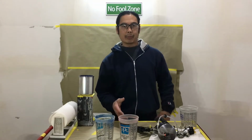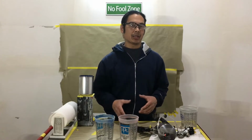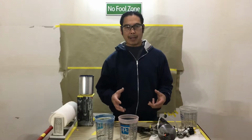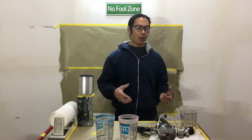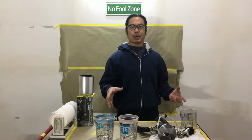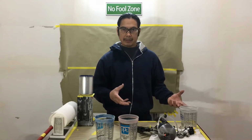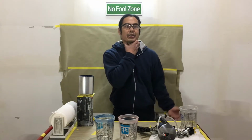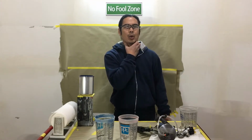And obviously, we are spraying with toxic stuff in the automotive world. That's why you need to protect yourself. If you're not protecting yourself, then you need to start now, because this exposure is cumulative. Your body will start to accumulate all the toxins from spraying if you're not wearing your mask. And I'm seeing guys who spray without a mask, and that's just not very smart, all right? One day, you're going to be spraying, and the signs of toxic exposure to isocyanates, your throat is going to tighten up. You're going to feel like you got a huge frog in your throat. You can't swallow real well.